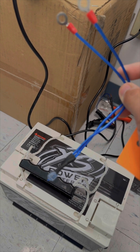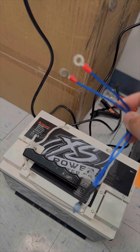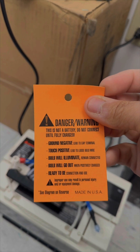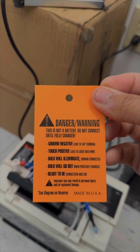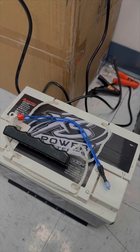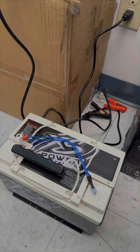This little resistor light will turn on, and when it turns off you'll know that the capacitor bank is fully charged and it's ready to install. The instruction sheet that nobody reads basically says you'll need to actually connect it through the resistor first because there are a lot of amps that can be stored in this unit.